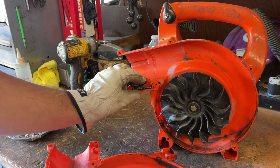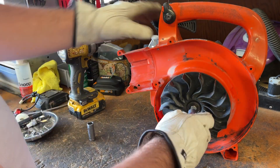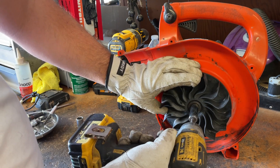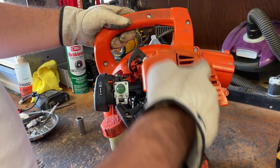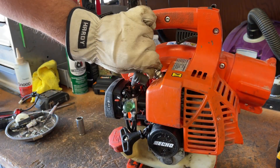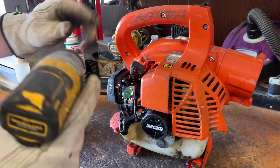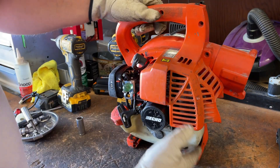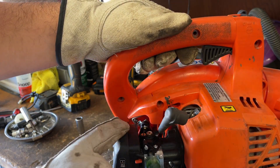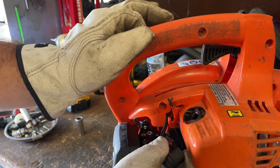Now you'll see — you don't want to lose this little guy. Now we have access to the impeller fan. These come off best with an impact of some kind. Counterclockwise to remove. Now we have four screws inside that we have access to. We'll be pulling those next. We're also going to have to pull off this back part of the cover. Get the spark plug out. Take all the aforementioned screws out. One thing to keep in mind when you pull this out — you'll have a linkage that goes down to the carburetor here. Just carefully pull this off.